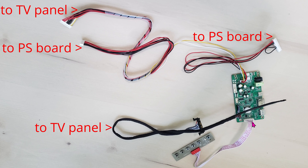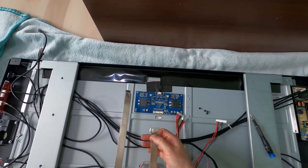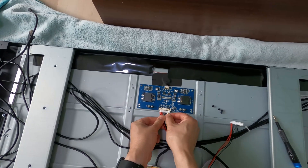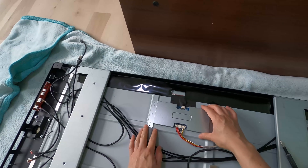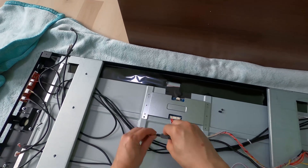We really don't need this extension board — you can disconnect it if you want and I'll show you how to deal with it later on. Here's the gray cable that we disconnected; this provides power to the backlight and you no longer need it. Go ahead and remove it, then insert this new cable — it only fits one way, so don't try to force it. After inserting the power supply for the backlights, go ahead and put the metal cover back using the four Phillips screws.